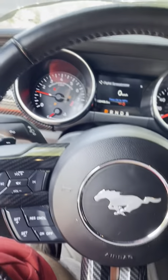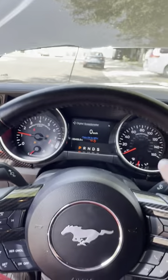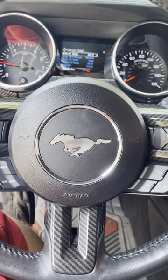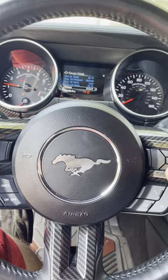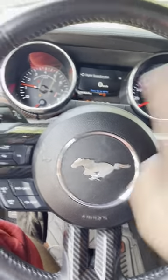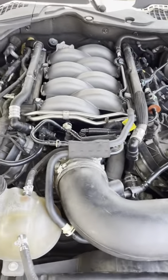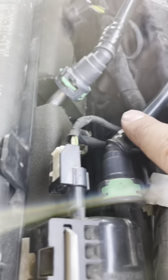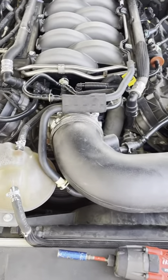That was a cold start so that's why it died - E85 life. Let it run for a bit, listen to the engine bay, look at your numbers. Make sure the air-fuel ratio is good and check your vacuum. Listen for any howling noises that seem like a vacuum leak, check the fuel to make sure it's not leaking, and make sure it's not misfiring. Engine is running pretty good, sounds good.